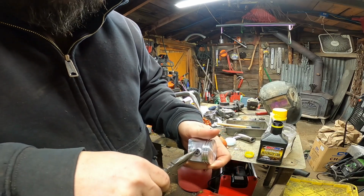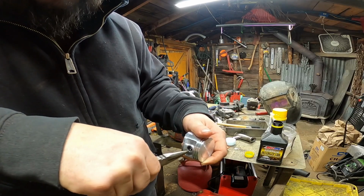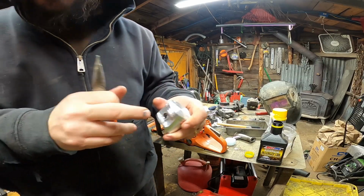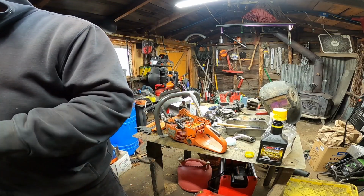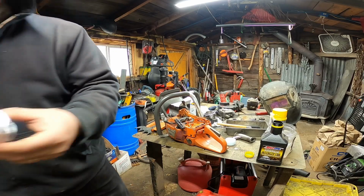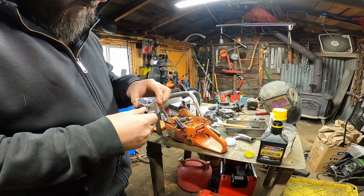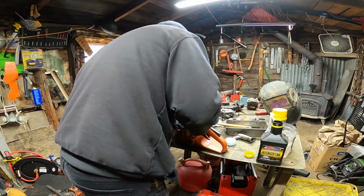The rotation, I do it for me. I grab onto one and I go right around and make sure it's seated, because I've already had one of these go through a four-wheeler. I had one come out on me, so I have a very love-hate relationship with them. Okay, so we've got them on one side. Now what we do, we've got to put the piston in here, arrow pointed towards the exhaust side.